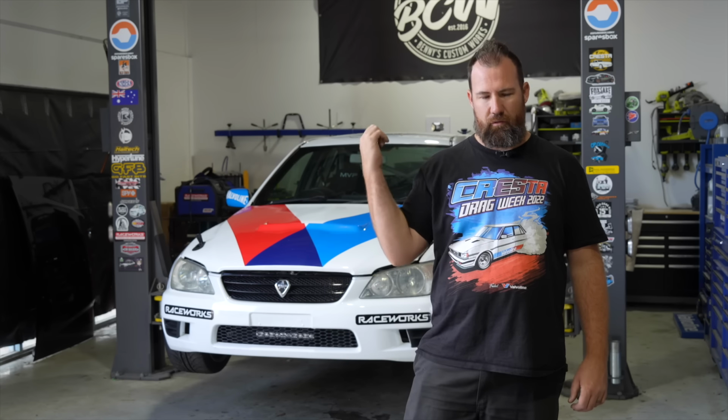I'm not super stoked about it, but I am happy to move forward with it. I've also spoken to Omar about potentially upgrading it, and he has some stroker kit options available for us that are pretty cost effective. I was actually surprised how cheap they are. So at this stage, we're probably going to go to about 400 cube with this, well, what was a 6 liter. It should give us some more cubes and some more torque, and hopefully a bit more power too. It'd be really nice to get a little bit more mid-range with it. I feel like it lacks a little bit in the mid-range. So having a little bit more punch, potentially even bump the compression ratio up as well.